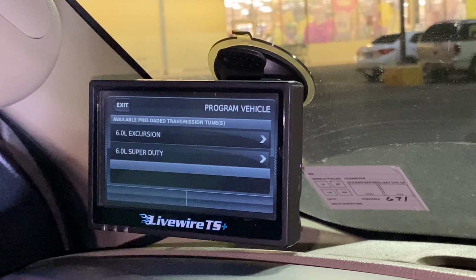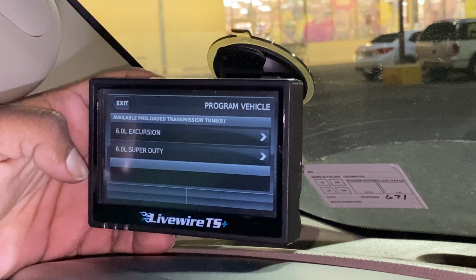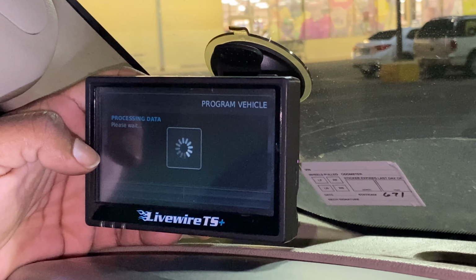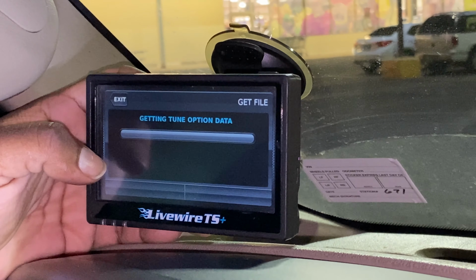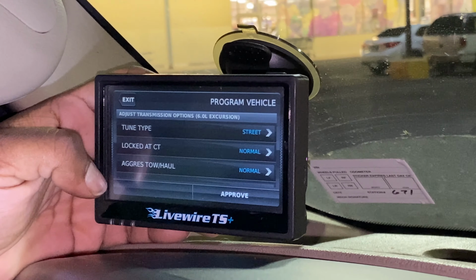I don't think it's a Jake brake because Jake brakes are physical things that sit in the head as far as the trucking world goes. But I think it's like an exhaust brake or an engine brake in some sense of it. I think it's pretty much using the transmission and the engine compression to slow down. It's not like a physical Jake brake that changes the exhaust timing.